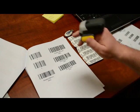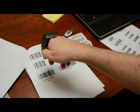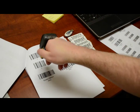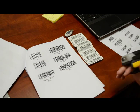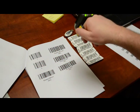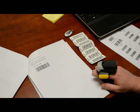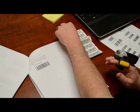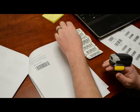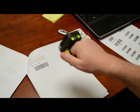Now this one is 'discrete length' — this is where you set how many numbers are on your barcode. In this case we have ten digits, so we need a one and a zero. Other customers will have a one and a two for 12 digits. The last barcode is the serial port protocol, which is used to work with the Bluetooth device. You can scan this whenever you want, but you must scan it.